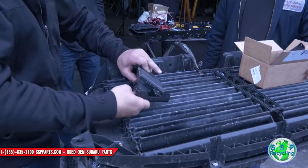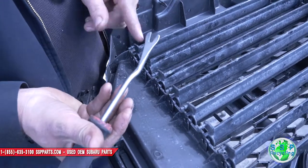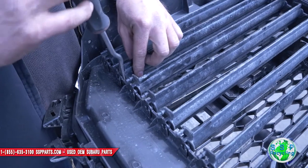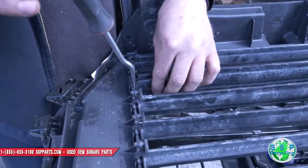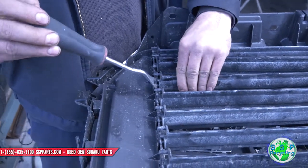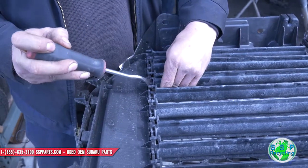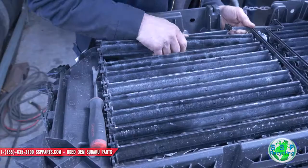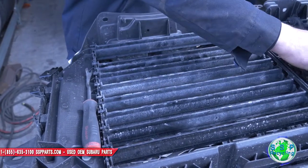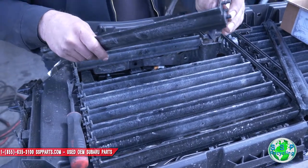This bracket bolts to this. In front of it, I'm gonna use this tool right here to pop these out — just put it in there like this, push ever so slightly, and pop that out. See that? Do the same thing over here on this one. That radar sensor sits at the very bottom, right here. We're gonna cover it with this bumper, so it's not gonna work there.